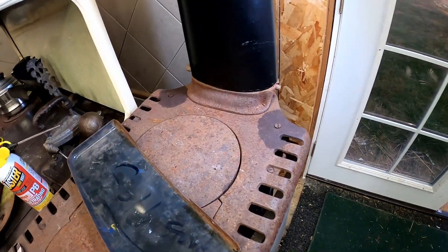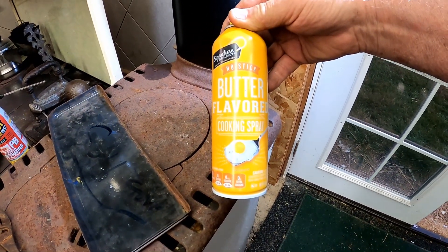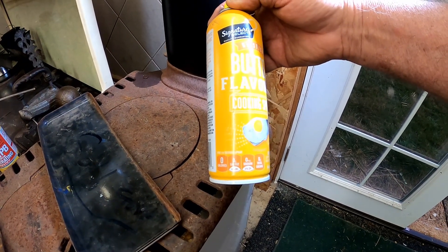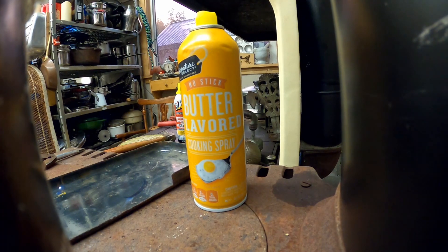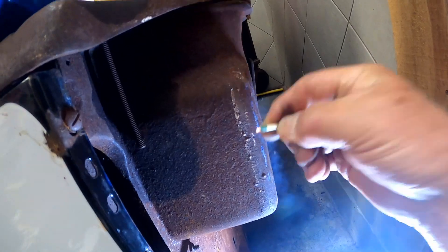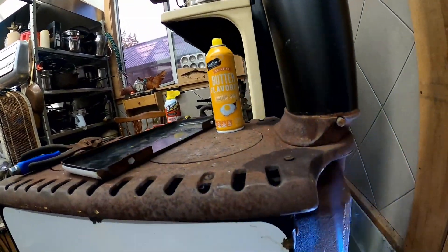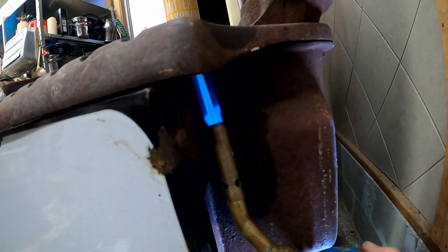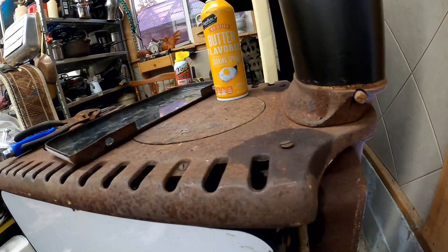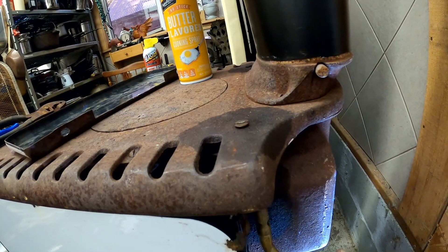What kind of oil? Not neatsfoot, not naphtha — you don't want to use that on a wood cook stove. What you do want to use is something you can cook an egg in: it has no added salt and it's fat-free. You can't beat that. So because we are using a cooking spray, we're going to need a little heat. That ought to work just fine, since that bolt has been heat-soaked in many cycles. We just need a heat cycle again to persuade it to come off.